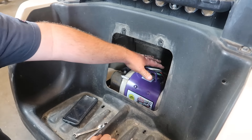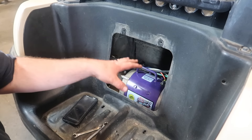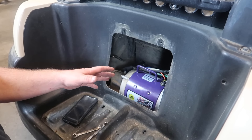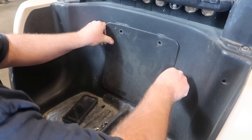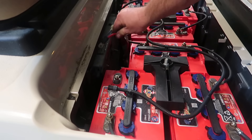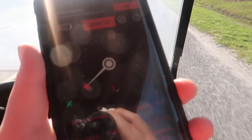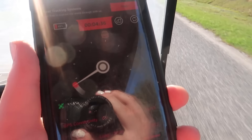Everything's back together and tight. What I like to do is take a couple of charge cycles after I run the cart down and recheck my connections to make sure they're tight and haven't come loose. Go ahead and put the cover back on and install the clips. Once you have the motor and everything in place, change it from tow to the run position and re-hook up the power wire to the battery. It picks up a lot faster now!